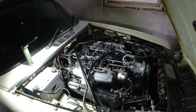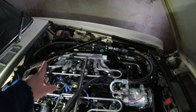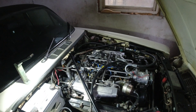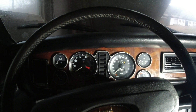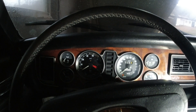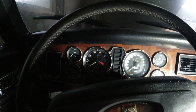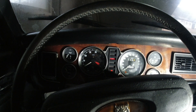Let's get into the car. On this car, when the whole fuel system is filled and it's just sending fuel back to the tank, you can hear when the fuel pressure regulator opens up. So hopefully that's working and hopefully it fires up this time. I've cycled the key several times and I can hear fuel returning to the tank, and I've gone out there and I don't smell any fuel leaks, so let's cycle it a little bit more and see what happens.